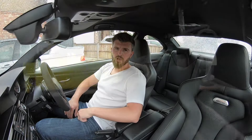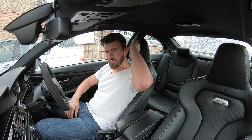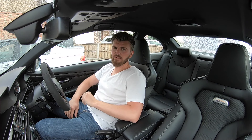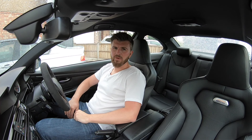In the M4 seats, we don't have any active headrests. In the facelift E92, in the event of a crash, they essentially pop forward to reduce whiplash, whereas pre-facelift cars don't have that. So it's a little bit easier in that sense on pre-facelift cars, but as you're going to need to do some coding anyway, it doesn't really make much difference. It's definitely easier on a facelift car because you'll have the correct modules under your seat ready to go.